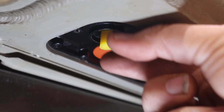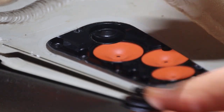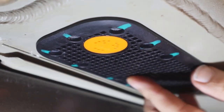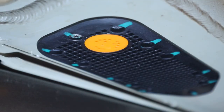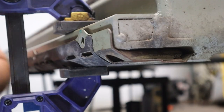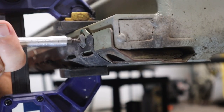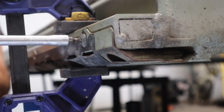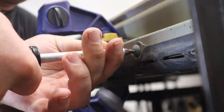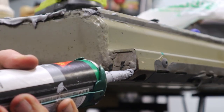Back under the front left corner, I've got to remove that little plug and replace it with the small Gore breather that goes up in there. After that, the cover with its mesh filter goes up in place, held in with a series of screws. Now that all the umbrella valves and plugs are taken care of, the ski side covers can go back on, using a series of clamps to hold them up so we can put the screws in without stripping them out. I also thought it would be a good idea to put a little bit of caulk right up in this front area.